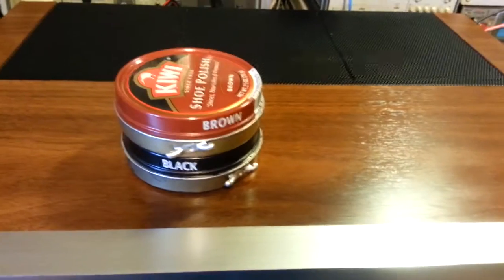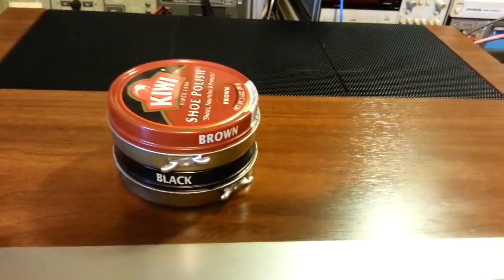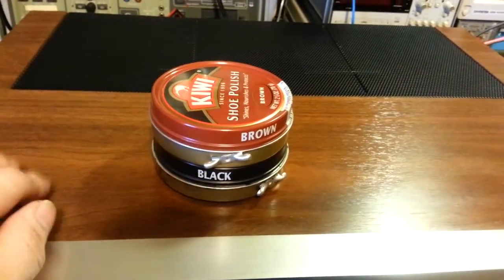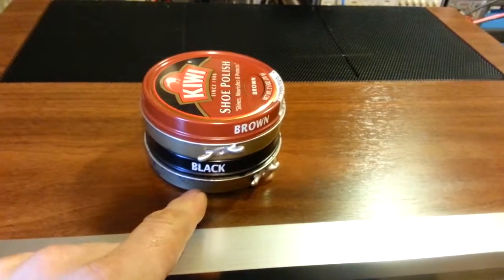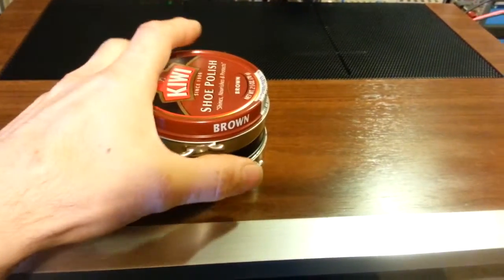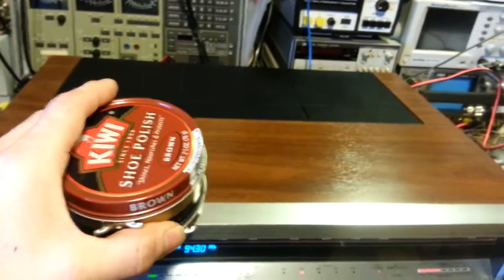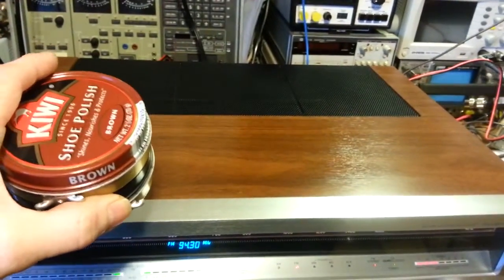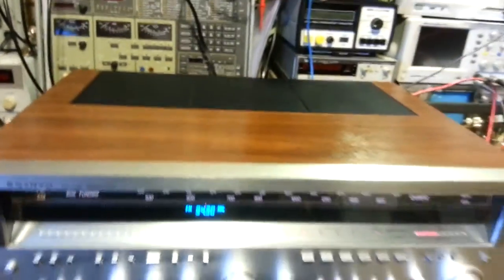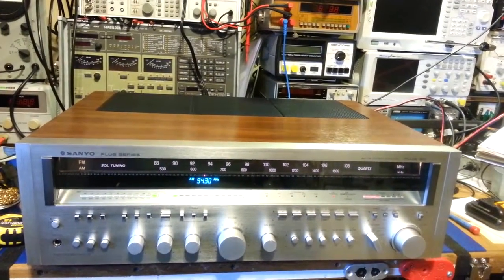The black works great for black painted surfaces, or even if you have CB radios that had metal covers with a vinyl decal — black, kind of a marbly texture. The black is great for cleaning and actually getting rid of sun fade on covers like that. It's very easy to apply — takes less than a minute to smear it all over the cover, let it dry for a minute or two, then just buff it out with a rag.